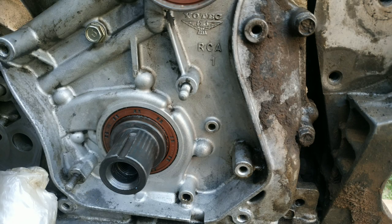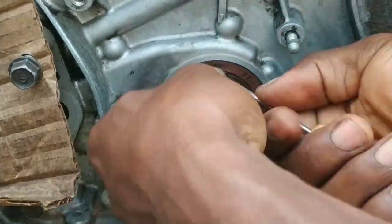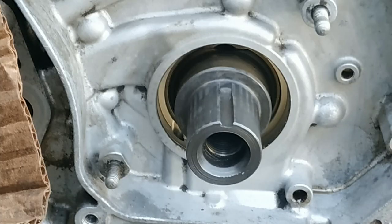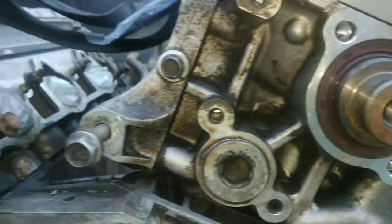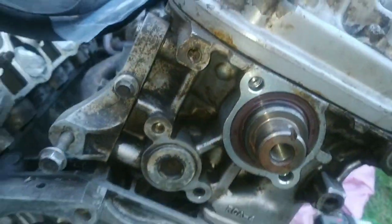After some clearing around the front crankshaft seal, using a pick, here's how I got the crank seal removed — I snuck the pick under the seal and then, when it was on there properly, pulled as hard as I could and gently worked the seal out. In installing the new seal, I followed the same procedure I used earlier for the rear main seal and got it fully seated in, flat and flush. After the seal was installed, I returned the crank sensor and the gear back to their proper positions. For the camshaft seals, I had to use my impact wrench to get the cam sprockets off, and then I followed the same procedure, reseating the two seals. Everything went on real smooth and I don't foresee any leaks at all.